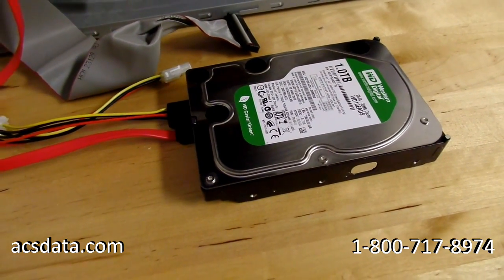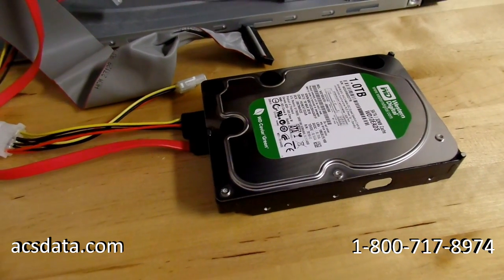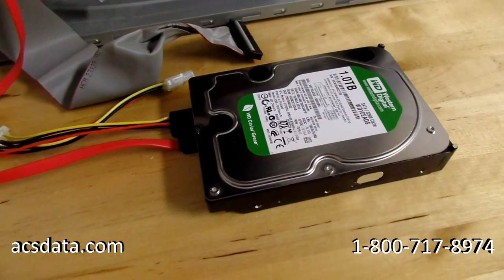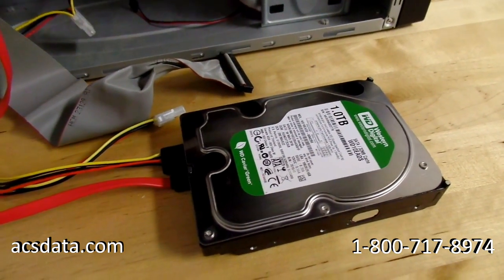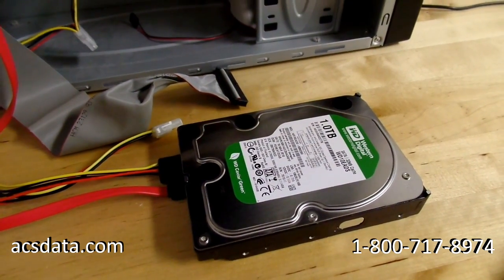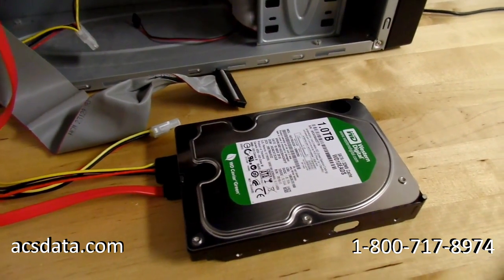With these drives, what we can see sometimes is the actual head assembly towards the tip of the head, where the read-write heads themselves are located. Sometimes there are components there that start to come apart. The big thing we see are the sliders, which look like just black squares on the end of the heads. A lot of people assume that those are the heads, but they actually are not.